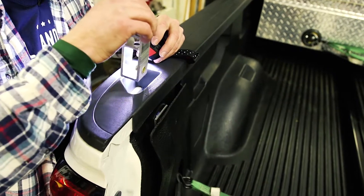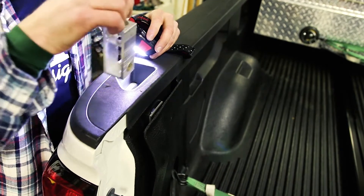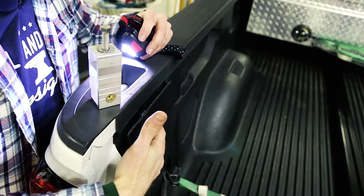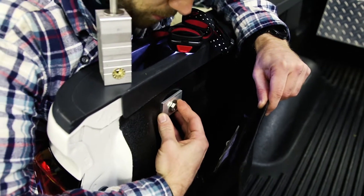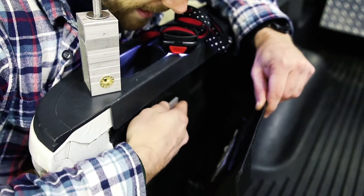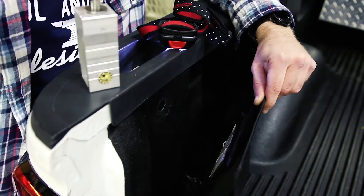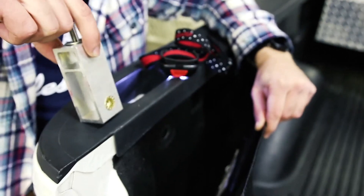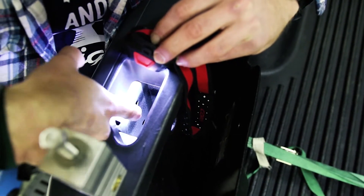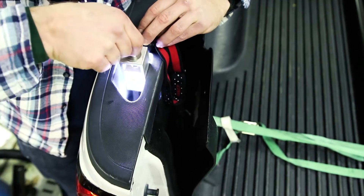With the post and beam on the back of the Silverado — this is the third generation 2014 Silverado — the mount will sit down right in here, and this top bolt will screw into your rear rack while this side bolt clamps down onto the side of your bed. However, when you tighten it down, the gap between the top edge and the side wall causes it to want to twist rather than sitting straight up and down. If you look inside, there's actually a second hole on the outside of your bed wall, and we're going to use that to install the post mount.